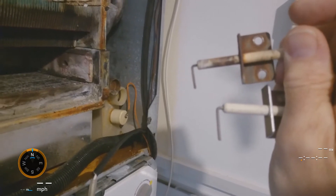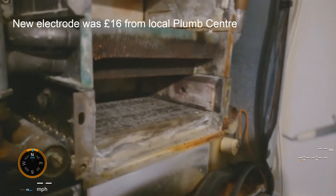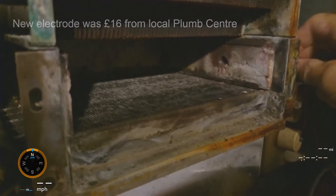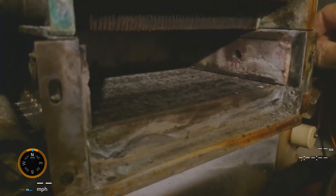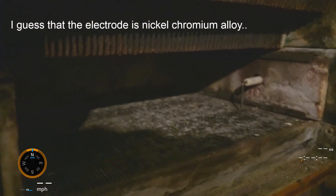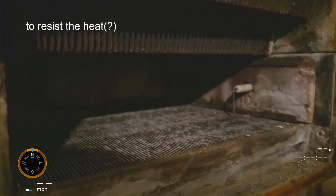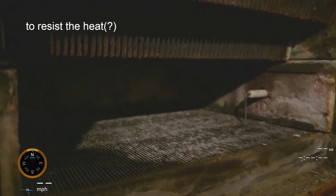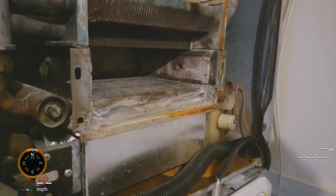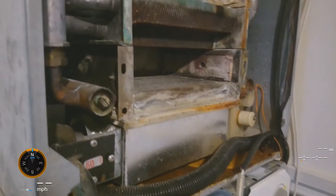So with a bit of luck swapping these two over, the new one will get that much closer to the burner. The gap there is probably only 5mm, whereas it was getting up to 10mm. I'm quite surprised that it's eroded so much, but I guess it's probably 10 years old now, so maybe that's why these things go.